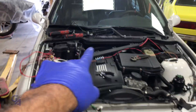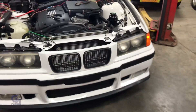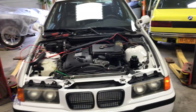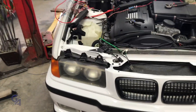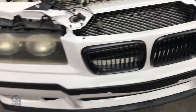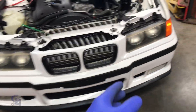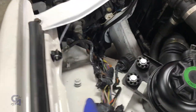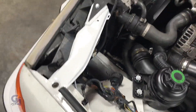So I hooked up power to the car and I got the headlights installed. I think the problem is a grounding issue — I think I forgot something in the harness. This is the ground for basically all these functions. So without the ground, you don't have that complete circuit that finishes and gets the headlights on. Turn signals, marker lights — none of it works. So we need to install the ground here and hopefully it'll turn right on.